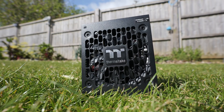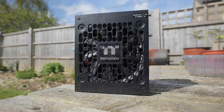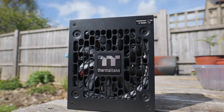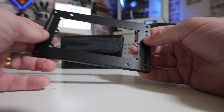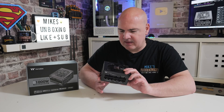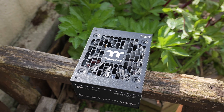This is absolutely tiny — I'm still not entirely sure how they've managed to make this platinum rated, up to around 95% efficient, very quiet, and this small. It comes in at a tiny 125mm by 64mm by 104mm, basically about the same size as a can of Coke. But don't worry — if you've got an ITX-type case that doesn't take an SFX power supply, Thermaltake have included an ATX adapter, so you can use this in an ATX case. On today's video we'll go through the specifications so you can work out whether this is suitable for your next ITX or small form factor build.